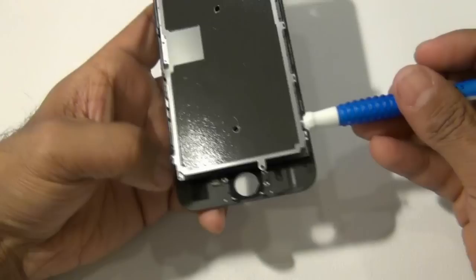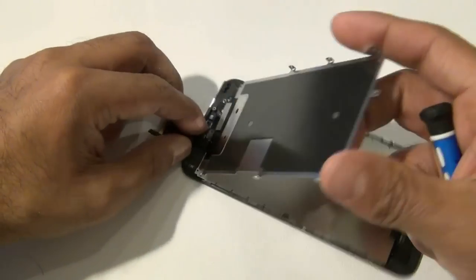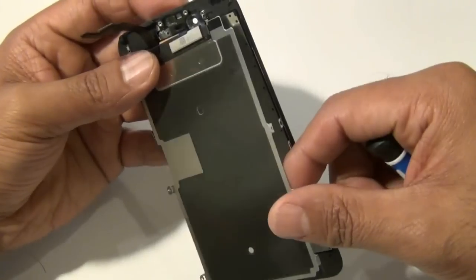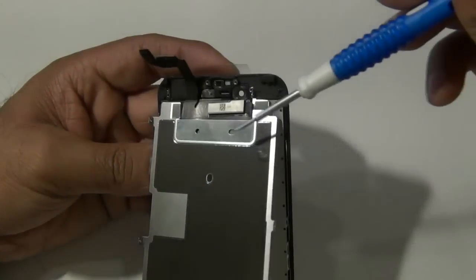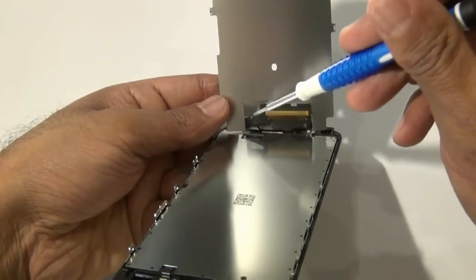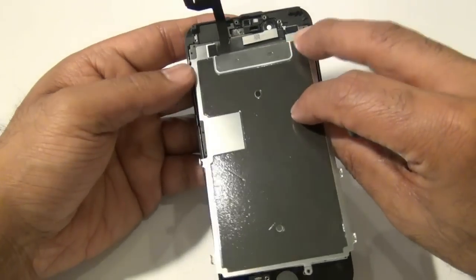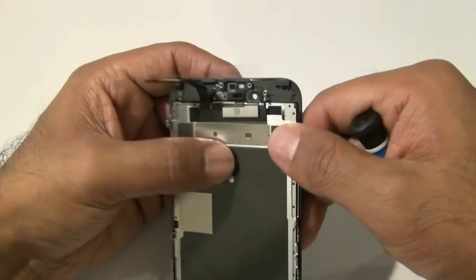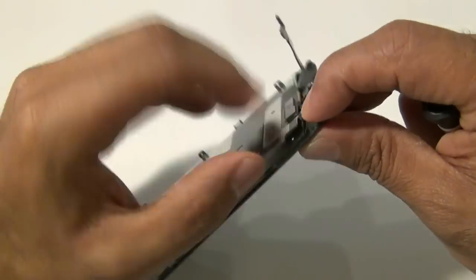With that removed, we will now remove the back shield plate. This plate is held in by a total of seven screws — three on each side and one screw at the top on the right-hand side. Remove all seven screws. You will need to swap this shield over to your new assembly if you are replacing the screen. Note it is connected with adhesive strips on both the front and back, so you will need to remove those adhesive strips to transfer it to your new screen. Now go ahead and reassemble, putting those seven screws right back in.